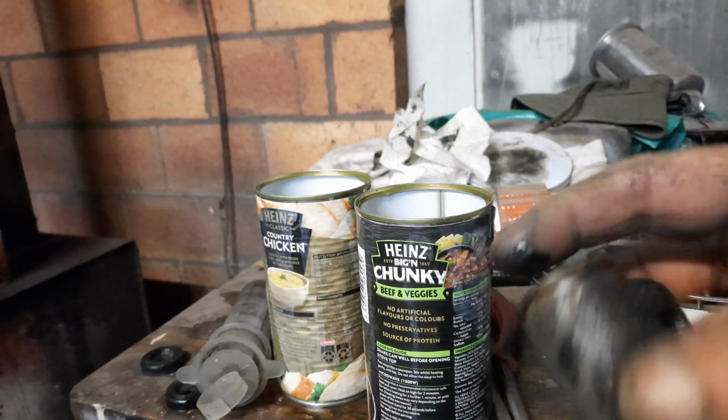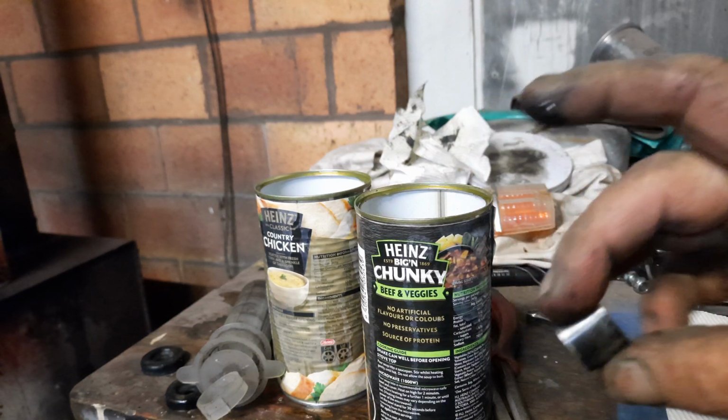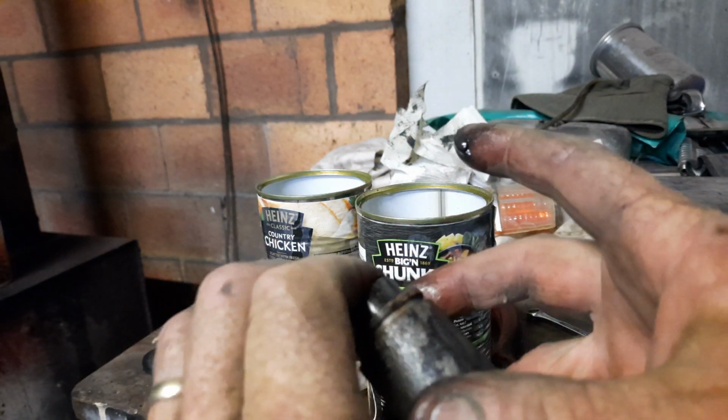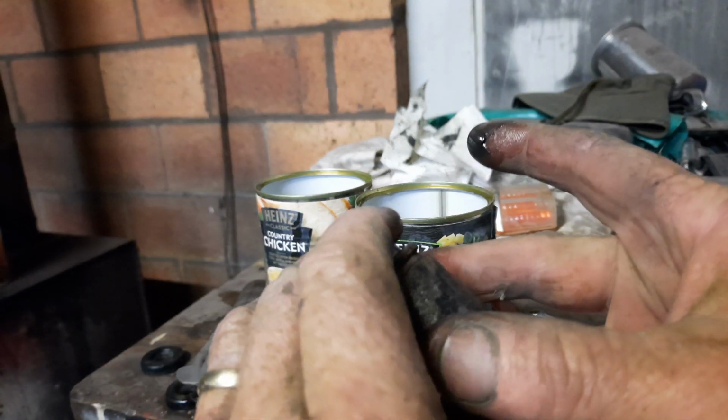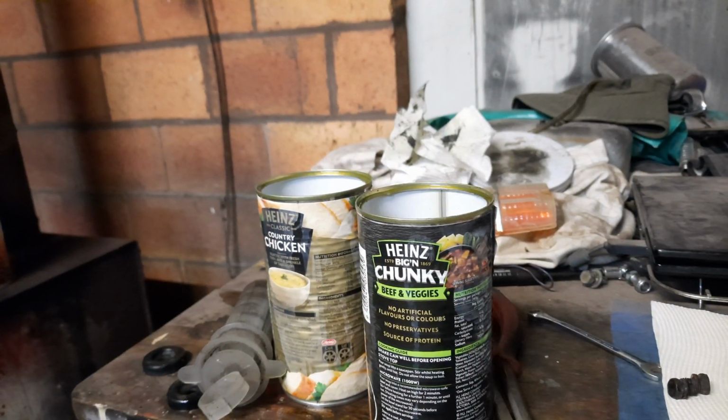Okay, so we've got the spring in there, 2 rubber seals, greased up a little bit. Do the same thing to this. I'll grease this up. So there shouldn't be any brake fluid actually getting on this. These are just rusted up from water getting in there. So now they're greased up. Just put them back in. You can probably hear it pushing the air out. Okay. Grease up the other one.